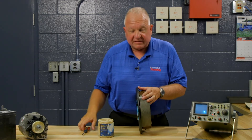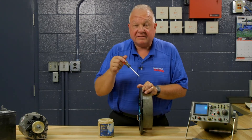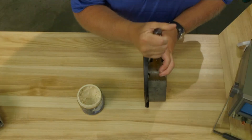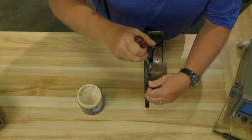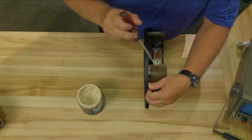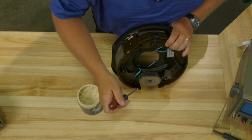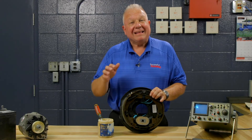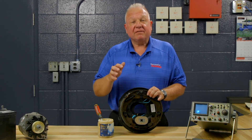What you can do is very simple. If you're taking the wheels off to check the brakes and you see that the grease has dissipated, melted, or was never there, you could take a screwdriver and just pry the shoe back. You would need two hands — put the grease behind the shoe, put the grease over here at the pivot point, and then down by the adjuster, and obviously grease the adjuster.